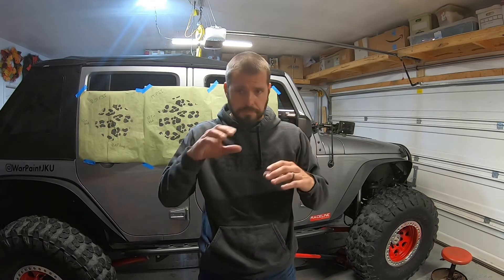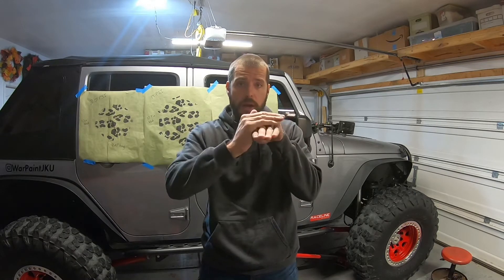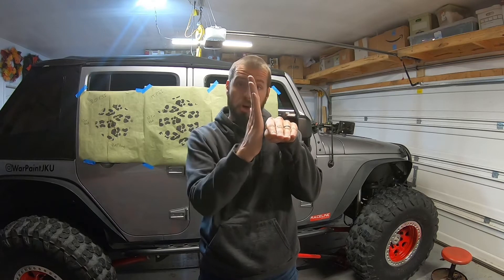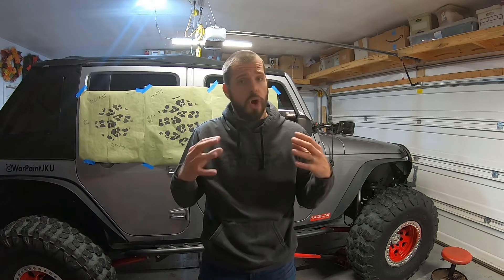The other benefit of running a beadlock is when you're trying to climb up over a rock ledge, your tire will actually deform around that rock ledge — similar to my hand wrapping around it — to help pull you up. Instead of keeping a perfectly round shape, low PSI allows the tire to mold itself around rocks and grab onto them. We all think of tires as perfectly round, and they are — that's what makes them efficient rolling down the street. But off-road, low PSI lets that tire mold itself around rocks and pull itself up.